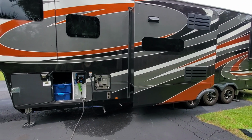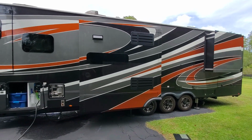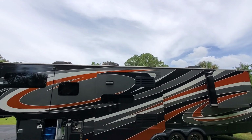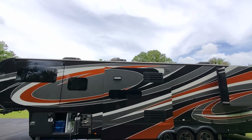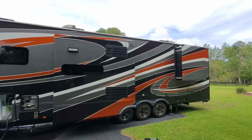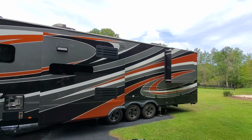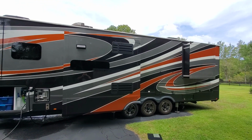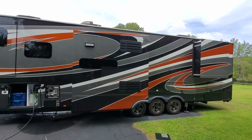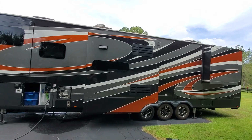the gray water and the black water tanks. Also, what we're going to do is those 3 Coleman Mach units up there, we're going to take off the shroud, straighten those fins, clean those fins out, take a little bottle of spray water up there with you and squirt some evaporator coil cleaner on it. Give it a few minutes, straighten your fins out.